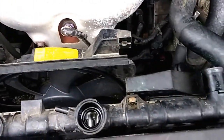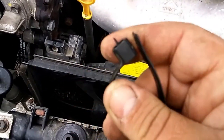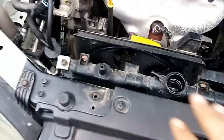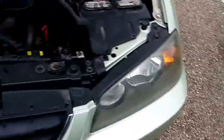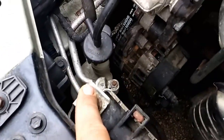I've gotten the three bolts across the front and taken that little tab down there that holds one of the lines up to the fan — loose. Now there are these little nuts back here that those three bolts go into. Be mindful if you're using an aftermarket radiator to make sure those are there on your new one. In my case it does come with new bolts and nuts. The electrical connector is off of this fan, and as you can see it simply lifts up and out of the way. I'll set these off to the side. I'll do pretty much the same thing — remove this electrical connector, lift this fan out, and then we'll be ready to get to the bolts that hold this to the condenser.